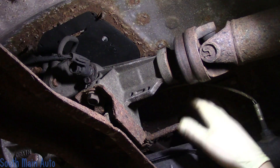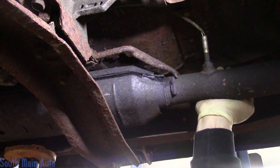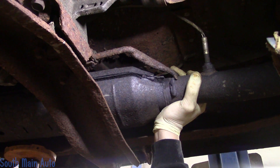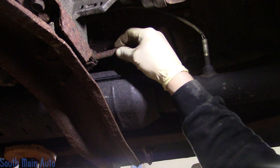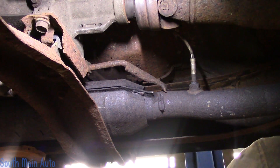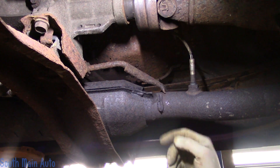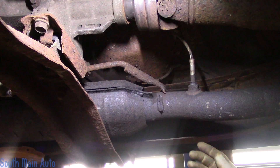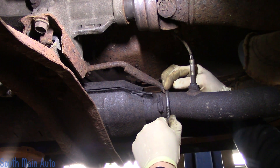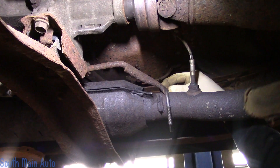The other noise is going to be here on the catalytic converter. The cat comes down and is actually hitting the cross member — when you drive you hear this thing banging; it's got some rub marks on the bottom of it. So this hanger here is pretty well toast. What we could do is fabricate a whole new hanger — just looks like half-inch rod. But this truck is pretty old and crusty, so I'm going to teach you an old trick. What we'll do is clean up and nick these off so we've got some fresh metal. Typically this hanger went down on this side and then down on this side — you can see where the old remnants are. We're going to take a new two-and-a-quarter-inch clamp, stick that around there, re-weld them — the weld will be strong — put the bottom back on, bada bing bada boom, done. Easy enough to do.